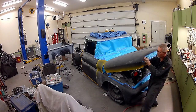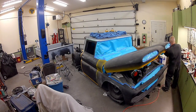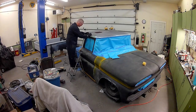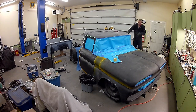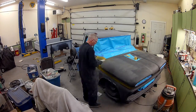Then I need to let the slick sand cure for about three days. I have used high build polyester primers in the past that were not a 2K primer. You lay it down, but you really need it to cure for like a week or two or three months or a year — because you think it's done shrinking as it cures, and then you sand it, and then it shrinks into the sanding marks underneath. So the 2K stuff should set up pretty good.